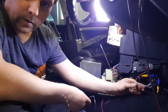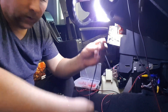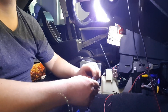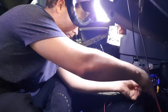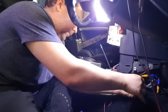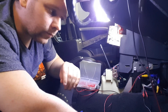Now with the wires I've cut over here, I've put a crimp on there — that's for the woofer that goes into the door panel. You get your woofer side cable on here — mine's come with two little pieces on there already. So with the positive you can connect these up with the woofer attached. What you've got to do now is plug the tweeter in — plug it under there. The tweeter's going in the A-pillar, that's another video.